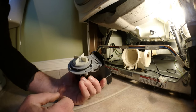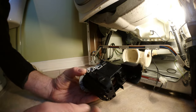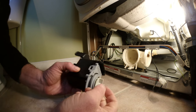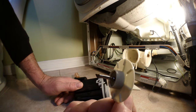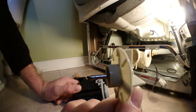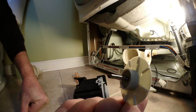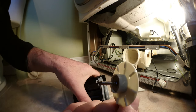Here's the pump I just removed. It was making sound like the motor was working but nothing happened. As you can see, the shaft just broke in half — probably rusted out. The motor is still good, but that's what failed on the drain pump. My washer is about 21 years old and this is the only issue I've had with it.